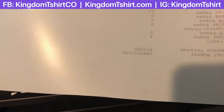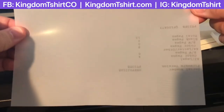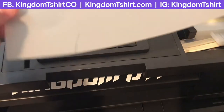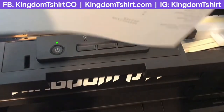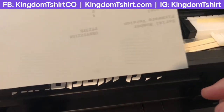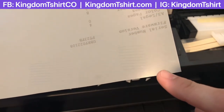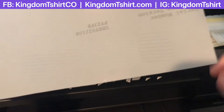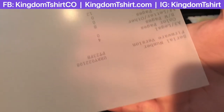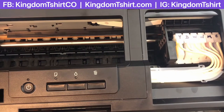This is how you do the nozzle check and make sure everything is fine. Basically I just cut half of the paper we use to print designs — instead of using the coated side that we print on, I used the other side, which is more shiny. I printed the nozzle check on the shiny part. I can see that it got all the lines, though the camera isn't capturing the yellow.